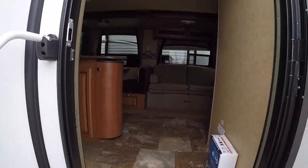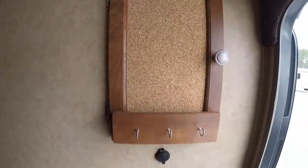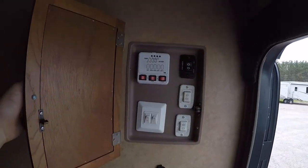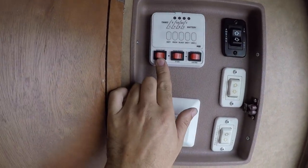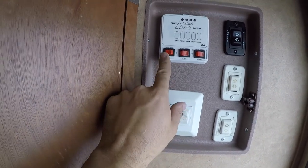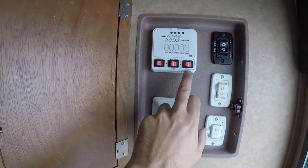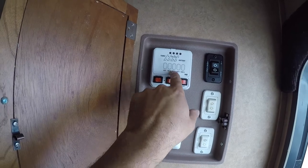On the inside, you walk in right here. You have a 12-volt plug for charging your phone or something like that. Behind this is your control panel for everything. You have your monitoring panel, which has the button for your water pump — so if you have the potable water tank full and you need water, that's your pump. You have gas and electric for your hot water tank: if you're using propane, that's your button; if you're plugged into 110 AC, you have electric. And this tells your levels for your battery, fresh water, black water, and that stuff.